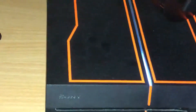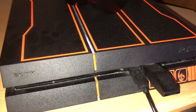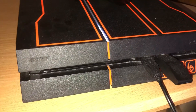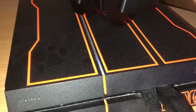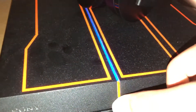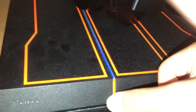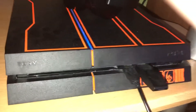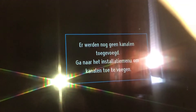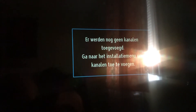What you want to do is close your PlayStation 4 and wait till it closes. Once the PlayStation 4 closes, hold the power button till you hear two beeps. One beep, then a second beep — this will activate safe mode. Then go to your TV or monitor and wait till the PlayStation 4 comes up on screen.